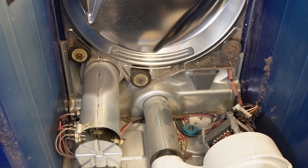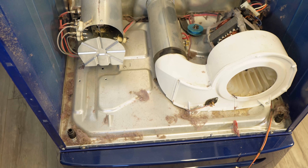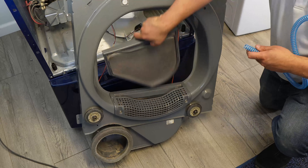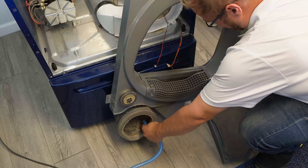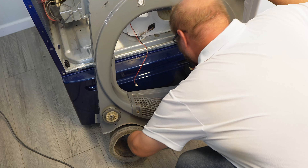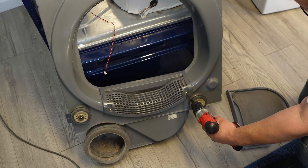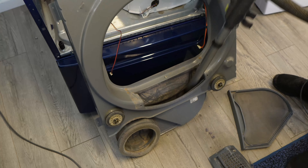With the belt away from the pulley, use the belt to lift the drum up and out of the dryer. Some versions of these Electrolux Frigidaire dryers could have cuts in the middle of the bulkhead to make it easier to take the drum out from the chassis, but others do not. From here, we have an inside view of the drum and its heating components, all pretty much located at the bottom of the unit. The two key areas to look at are the heating canister and the blower housing. But before we test some components, look at the filter housing for any lint buildup. I used a flexible vent hose to clean the inside of the unit, but eventually reached up and grabbed a huge ball of nasty lint, which would cause it not to dry but would still allow the unit to heat.